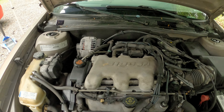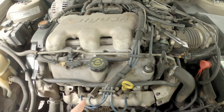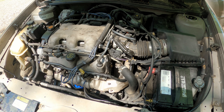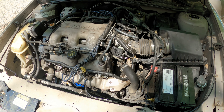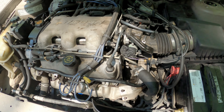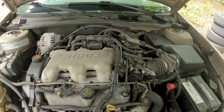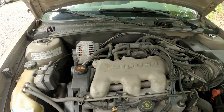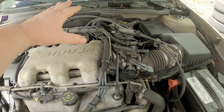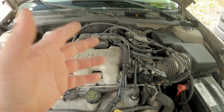Here we have the large port 3100 in this Malibu. Some stuff's already been done to it - it's got new spark plug wires, the plugs have been replaced, and it does run good. The only problem is it has a pretty nasty lifter tick, which we'll insert some video of. It's pretty bad sounding and it actually causes it to miss when it's cold. There's also evidence of fluid leakage that I think is lower intake manifold. So we're going to pull the lower intake off, do valve cover gaskets, lower intake plenum gaskets, and while that's all apart we're going to throw lifters in because it's really easy once you're down that far.